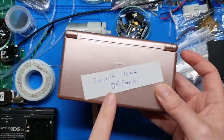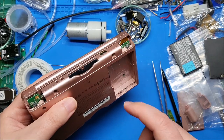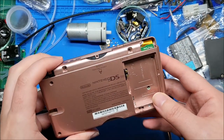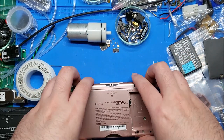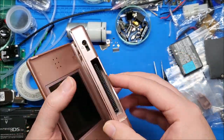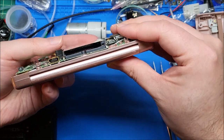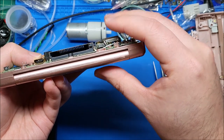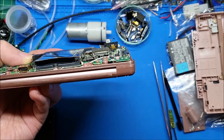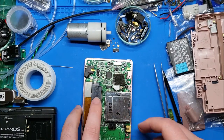He said it does not want to read games. I'm not even going to stick a game in there, because there are horror stories of damaging games with dirty contacts or misaligned pins. But I am going to plug this in under the microscope and look at whether I can see what the damage to the cart is. If it's just dirty pins, we'll give it a clean. If it's something more serious, we may need to replace the actual cart reader. Some of the pins towards this end are not looking very happy — they're kind of bent up and diagonal, possibly touching adjacent pins. That's definitely not good.